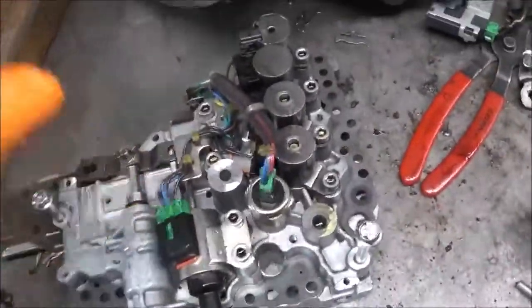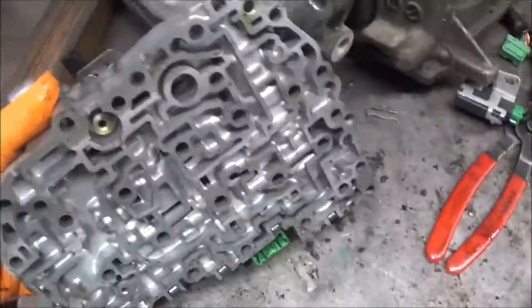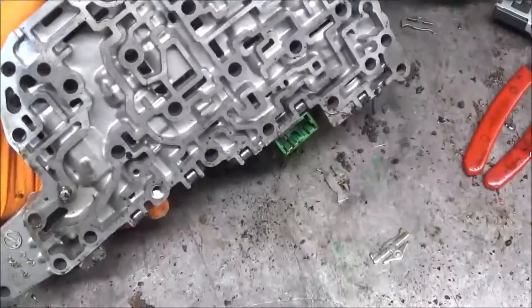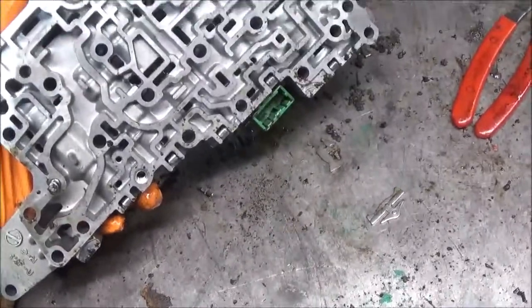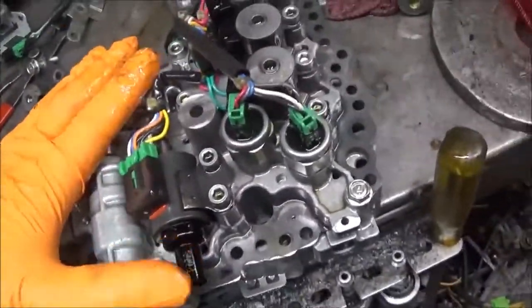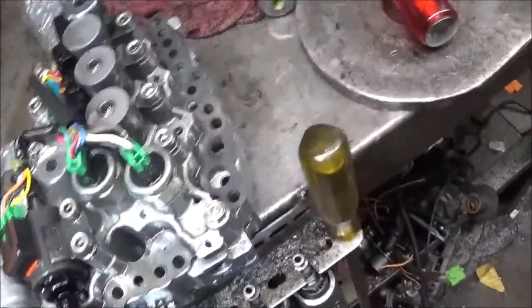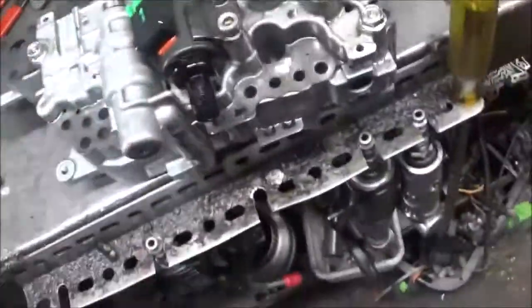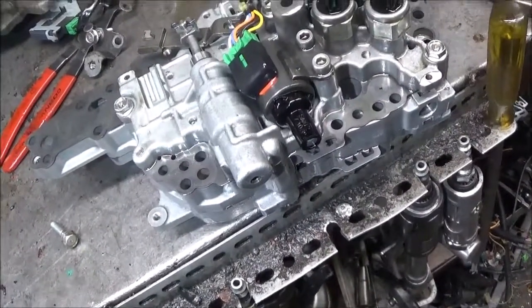We're going to put his correct valve body back inside the vehicle. When this transmission came in, he had already taken part of his valve body apart while it was still inside his transmission. That's why I didn't bother it further — I just decided to put a whole new transmission in, because I wouldn't know if something was missing from that valve body. But this is the wrong valve body, and it explains why we're having these solenoid codes — something is not right here.